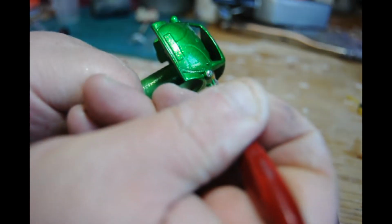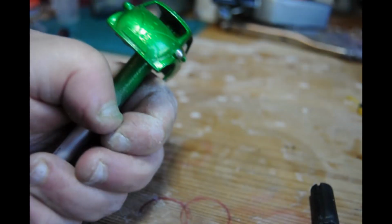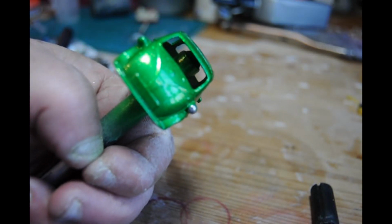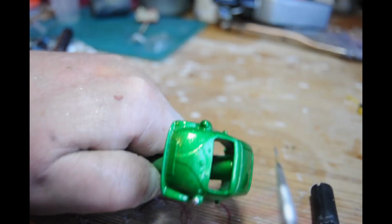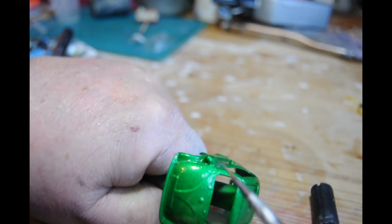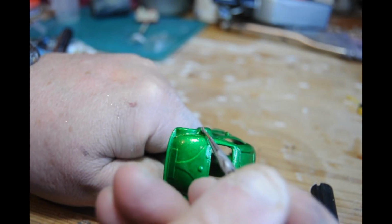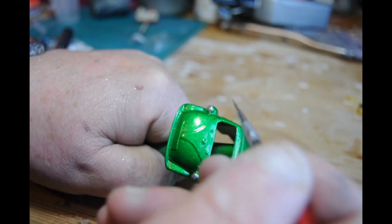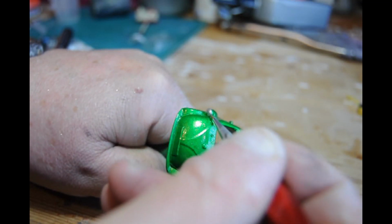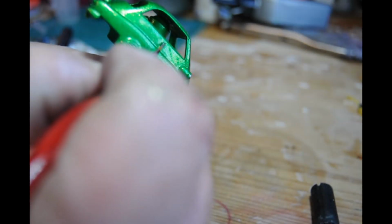I could do with retouching up now after the, what do you call it, roundabout thing, turntable. Jeez, memory's atrocious. But yeah, I think really I should start, at points, leaving them longer to dry, because really on this it would have been absolutely storming, but I've got a couple of marks in the paint through being impatient and touching it. I should really allow a day so the paint can cure better with cellulose.